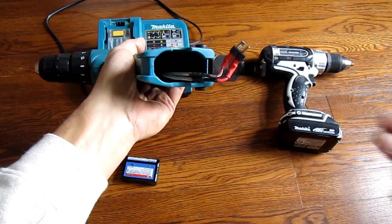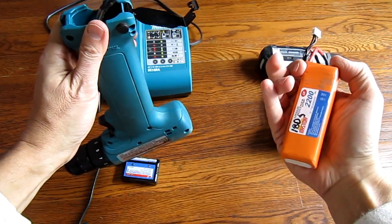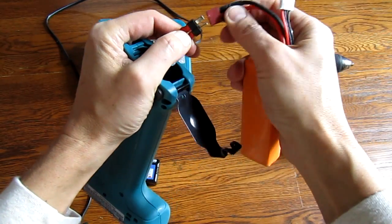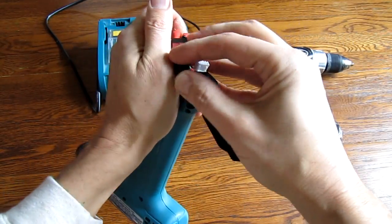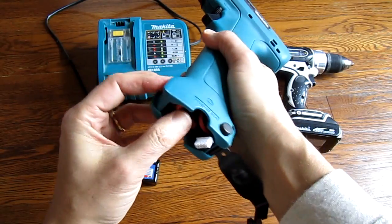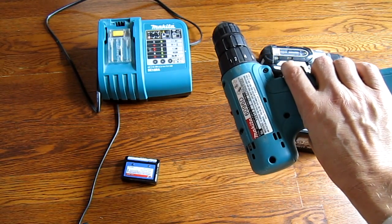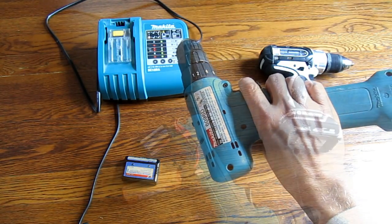These connectors are commonly used for people who fly airplanes or helicopters. And here's a 2200 lithium polymer battery — it's 11.1 volts. So you just have to connect this in, pop this in the drill, close it, and once again I've got a drill that works great. This drill was originally supposed to have a 9.6 NiCad battery, but it works fine on a lithium polymer battery.